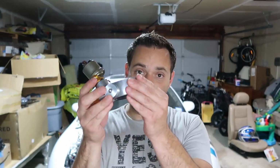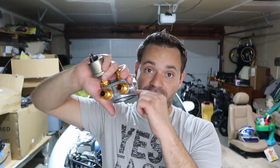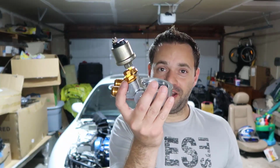So this here is the adapter, right? Forget about this part here. This is the adapter, and you have the pipes in here, right? The fittings in here. So one is the input, the other one is the output. More than that, we have two extra connections in here, where we can put the oil pressure. So this is going to my oil pressure gauge, which goes inside the car. So it's great because I don't need to put it behind the engine, I can leave it right here.